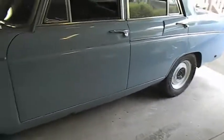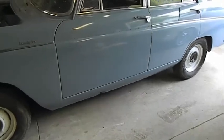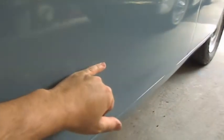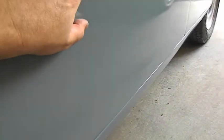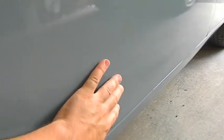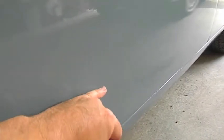I want to talk about the body work — it looks absolutely brilliant, but it's not up to par yet. It's full of orange peel. If you look at the reflection of the light, you should be able to see all the peel. The reason they call it orange peel is because it resembles the skin of an orange. We have to colour sand that out and buff it to make it look good. The original paint on the car is very peely as well. I've painted around up to here and blended it, then cleared higher. If I colour sand the repairs without clearing it first, I'm going to colour sand all that blending off and end up with a defined line where the paint is laid on thicker — that would look really bad. So you need to clear coat over where you've blended.